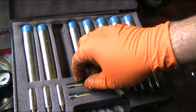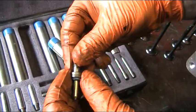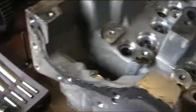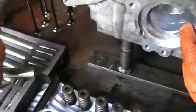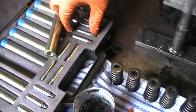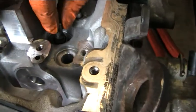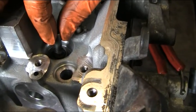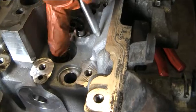Then approximately this size of a guider. We'll come over and try this into the guide before we fit it into the tool — maybe go for a slightly larger one. Nice and snug. This centralizes the valve stem seal as it gets pressed onto the valve guide tube.